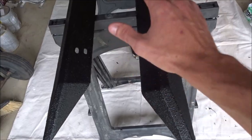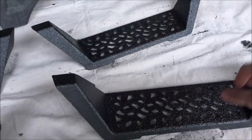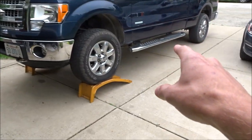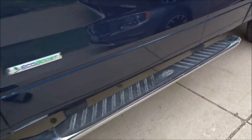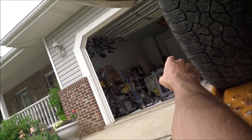As you can see, the original texture was there but it wasn't very grippy. These new ones are very texturized, so I shouldn't be sliding off now. This paint wasn't too bad. We've got to start by removing the old running boards — should be just a few bolts underneath. It is very dirty under here, and I do have rust starting on the pinch welds, which I'll have to take care of at some point. We have two bolts here and two bolts there, and then the side steps come right off.